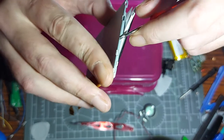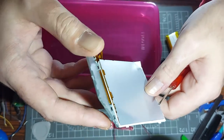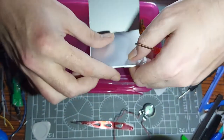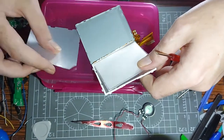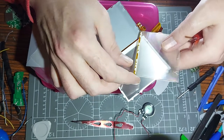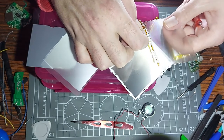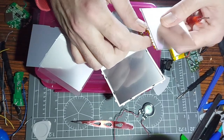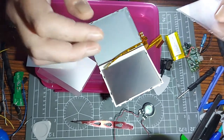Oh crap, that's a bit of plastic - I've totally messed the screen up here. But it was totally buggered anyway, had a big crack on the bottom of it. Here, if you look, you can see this little ribbon thing on the other side - this is the LED. So what we need to do is try and remove the polarizer and stuff. It tends to stick to one of these layers - the trick is to not yank it. Push it from the right side, start from the bottom because that's the most vulnerable spot. Lightly pull it away.